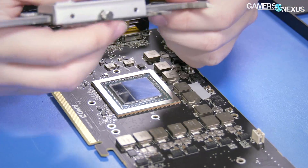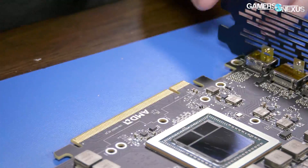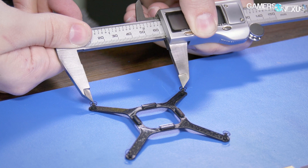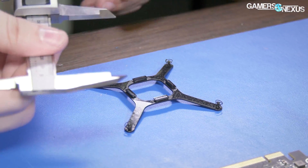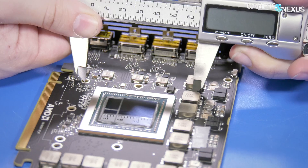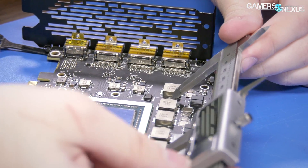The HBM measures about 10 by 11 or 12mm — let's call it 12. Now for the mounting hole distance for liquid cooling enthusiasts: measuring across, we get 64mm. Rotating to check the other axis — that also looks like 64mm. So mounting hole spacing is 64 by 64mm. That's your answer if you want to liquid cool this card.